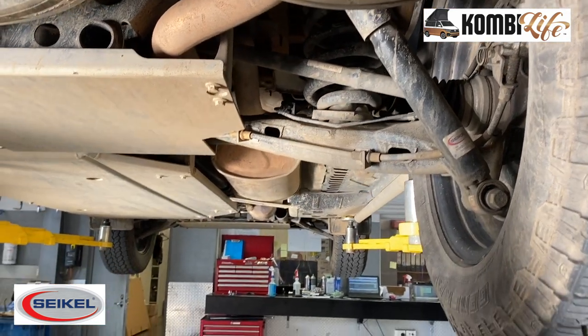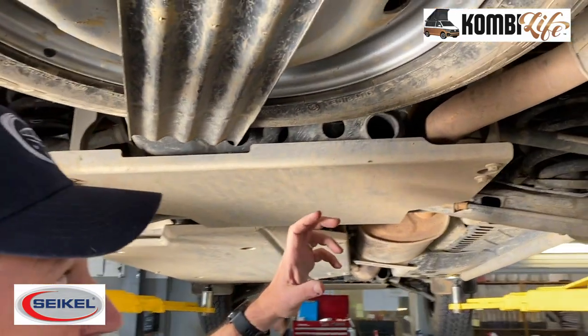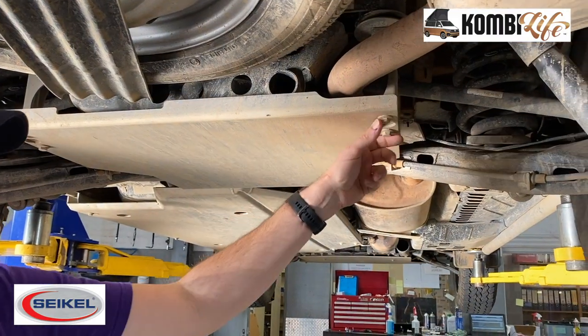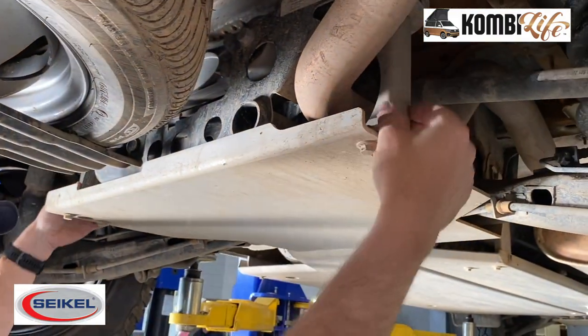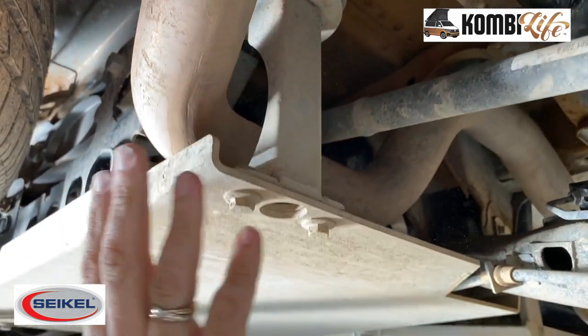If the diff was not dropped just a little bit, we would have greater stress on these and potentially further shorten the drive shaft life. We also have five protection plates on this vehicle. The first one is the rear diff protector — this is a bolt-on plate. In the kit comes the spacer kit, which creates the new mount brackets here for the plate.